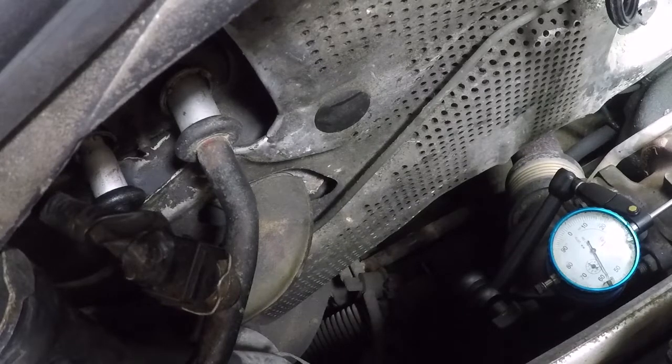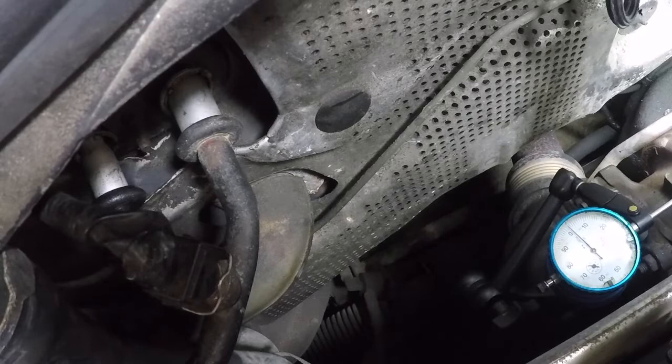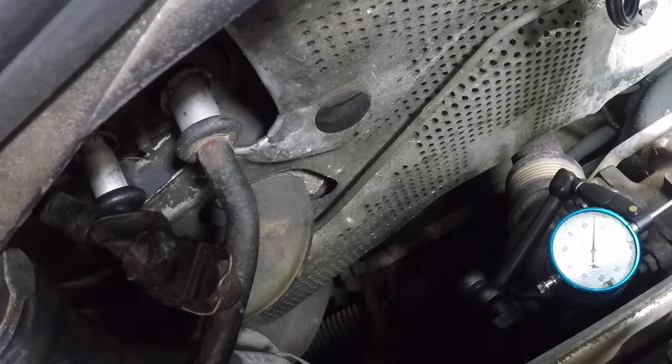What if that thing is opening too early and it really can't build the pressure? It should, because the wastegate is out of adjustment. As far as I can tell, this thing should be opening about four PSI to start to move, not moving at one and a half to two PSI. You can see that on the gauge — it shouldn't be moving there. It should be building up a little bit of pressure.